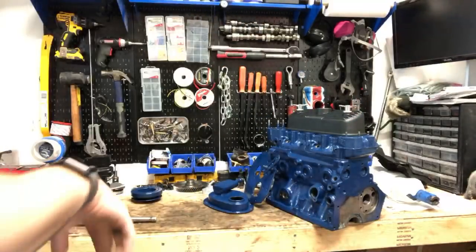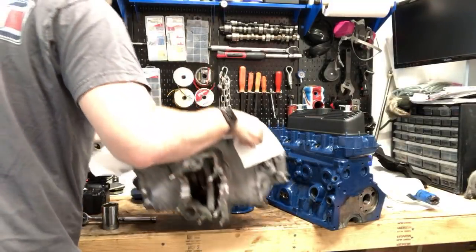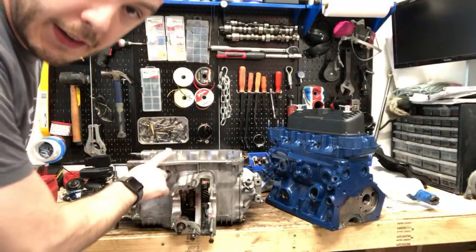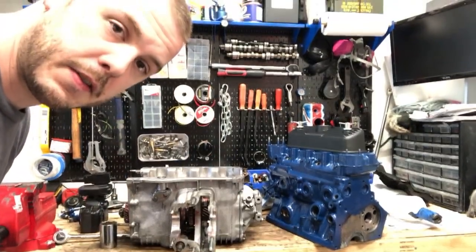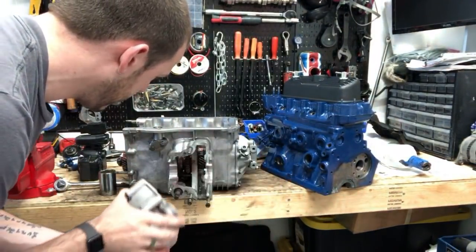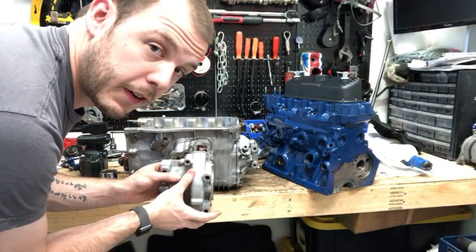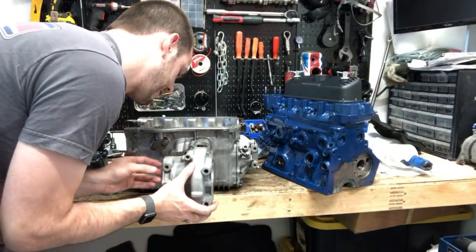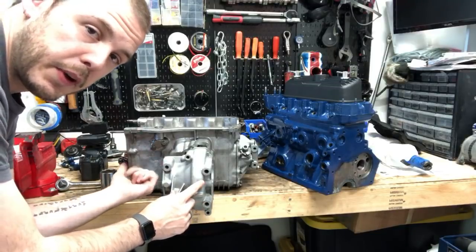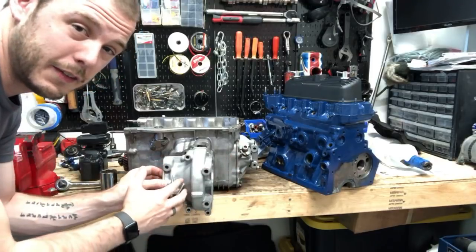All right, so this gearbox, let's bring that down. And your differential sits here. It's kind of unimportant right now for what I'm showing you, but this cover, and it looks a little different on later models, but this cover right here goes on, and there are 2 output shafts that run to your wheels and your drive shafts. And right here, this is really notorious on both sides for leaking.